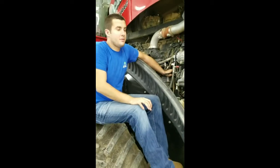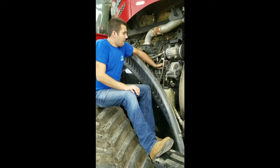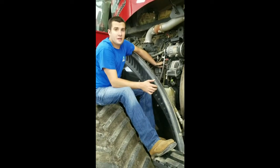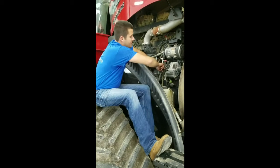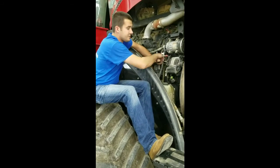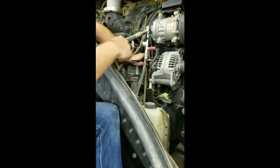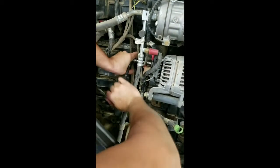Now here we are getting ready to wire up your hot and ground strap to the alternator. This is a 16mm socket — that's what the nuts are on the alternator. In order to get those off, just get a 3/8 drive ratchet with an extension. Pretty easy, pretty simple to get to. Just loosen up the hot strap as such.